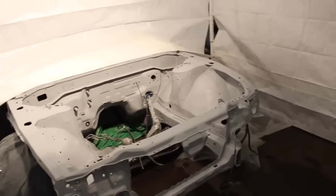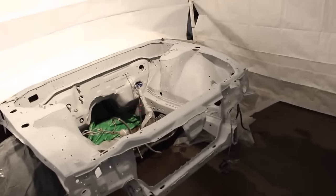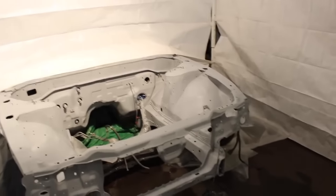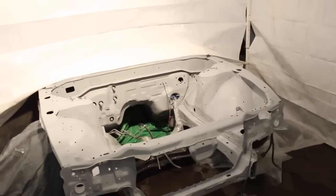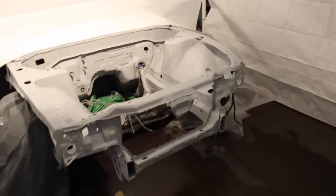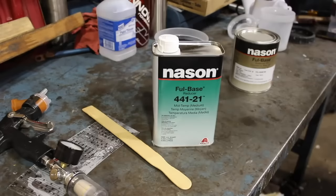I'm going to show you guys what we have going on in the engine bay right now. We're going to go ahead and mix up some paint, I'm going to show you guys what color we're working with, mix up some clear, and hopefully we get a nice result at the end of this thing. Everything is cleaned down. If you guys haven't seen my previous video — not the whole prime the engine bay video, but the previous video — we went ahead and sanded down the engine bay with some 600 grit, and it is basically just ready for some base coat. So once this is painted, the motor can go back in.